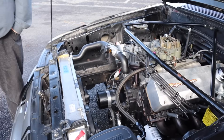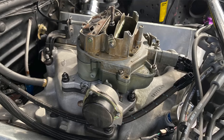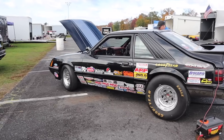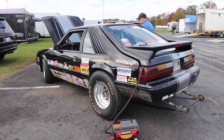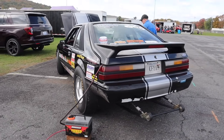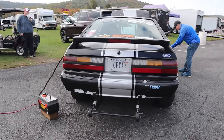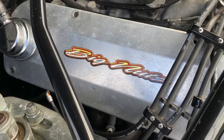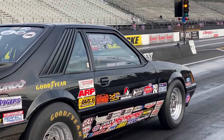So what is the factory horsepower rating and what is the NHRA rating? It was 280 and now it's 272 — got it down eight over the couple of years, and they'll let us do it. How much power does it make? 510, 515. What about torque? That I don't know — I'm just basing it off other cars that have run the same. Do you rev it pretty high? No, I only shift it at about seven, and it goes through like 75 mph. What are you leaving at? Four, 42, 44 — somewhere in there. It just gets up and goes. Best ET this car has ever run with this combo? 10.39 or so, about 125 at Rockingham, four or five years ago.